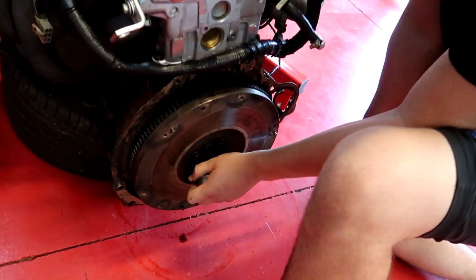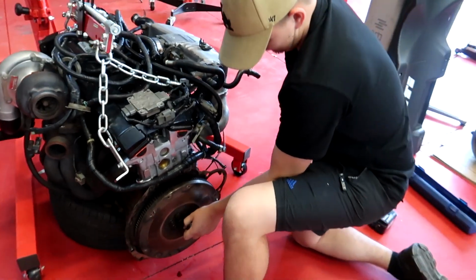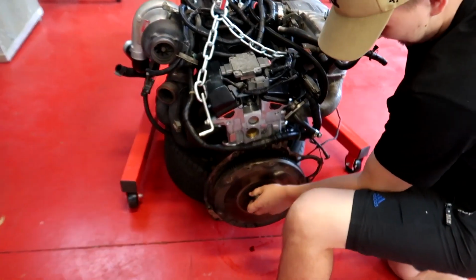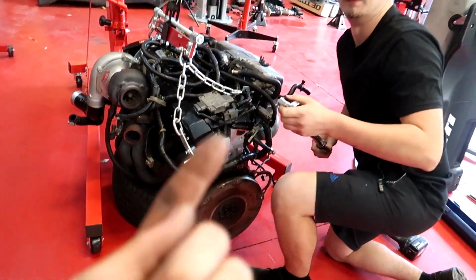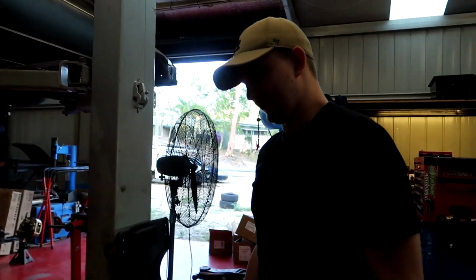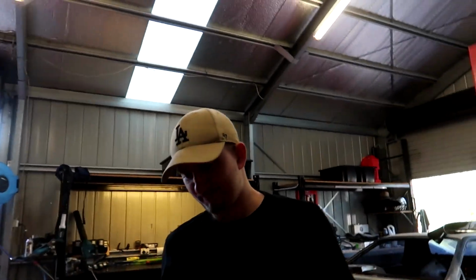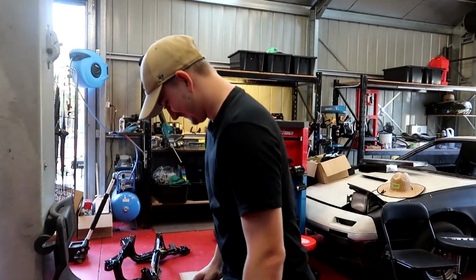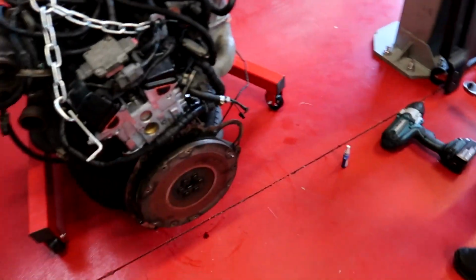It's probably the only thing that I actually torque is clutch stuff. Like everything else is just dugger-duggers. That's the last thing I want flying off. Yeah, 100%. Have you seen photos of that before? I've seen a drag car and the clutch came up through the freaking floor, out the roof. There's another one on a dyno. Came out the side of the car and killed someone. Really? Far out. So yeah, you want to get this right. Definitely torque them. Take the extra 5-10 minutes it takes to torque it. That's the last thing you want coming back.